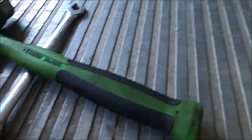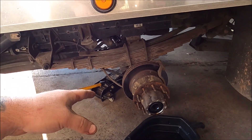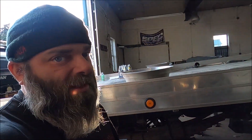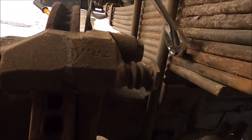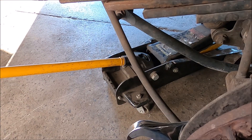Caliper's off. We've got to take these two big bolts off right here — these are an inch and 3/16ths and they are in there like a bandit. So what we're going to do is use our jack here and our wrench, and we're going to break them loose using the jack because these are torqued down to like 200 foot-pounds. Before you ask, 'Andy, why don't you just use an electric gun or air gun?' — because no half-inch gun is going to take them bolts out. You either have to torque them out with a wrench like this, or put a long extension on a socket. The top one doesn't have enough room for a socket and ratchet, so that's why you've got to use the wrench.